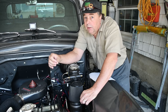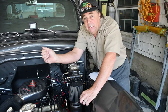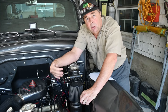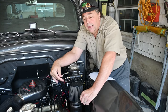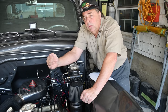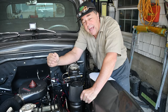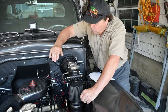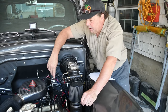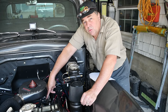It could lower it a little bit if it had to. It can raise it quite a bit if it needs to, whether you've got a load on it, you've got it in gear with an automatic with a tight converter, or air conditioning. It will allow that idle air control motor to open those butterflies and add a little fuel and keep you at a nice steady idle. So what we're going to do is take the screw that looks like your idle screw on the carburetor.